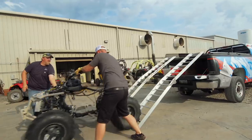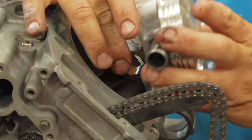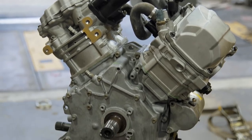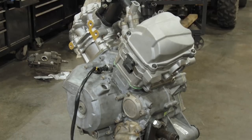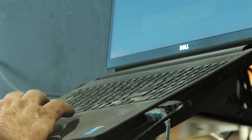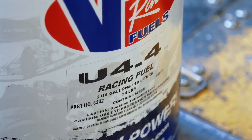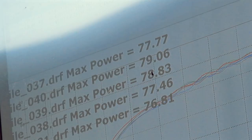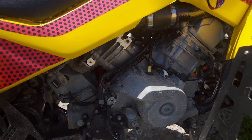After this, we made a visit to Mr. RPM in North Carolina where the motor was our focus, choosing to install a full 860 kit along with Maverick heads, solid motor mounts, Mr. RPM valve covers and water necks, new main bearings, throttle body boring, and a reflashed ECU. We ended up with over 60% greater power than a stock 800 at 79.5 horsepower at the rear wheels.